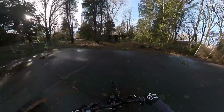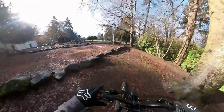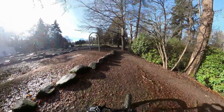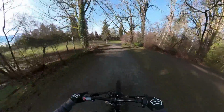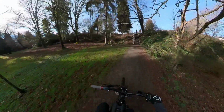So first off, the sprocket is sick, dude. I actually didn't end up losing that much top speed at all. I reset the top speedometer. What does it say here? 48 miles an hour. Holy shit, we gained miles per hour. See, this is the benefit of going to that non-O-ring chain. The O-ring chain has literally rubber O-rings. They cause so much resistance in the drivetrain that it lowers your top speed like crazy.